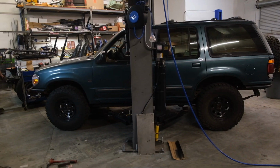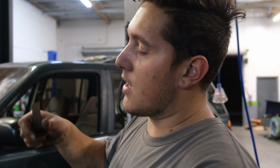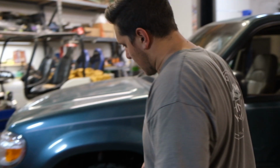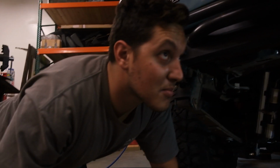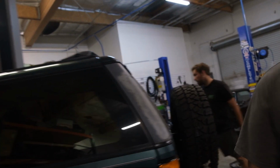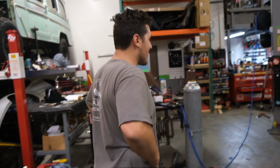Right now, it looks a little bit low on the front. Realistically, we should have tightened down the spring first, and then once we loaded it, that's when the limiting strap goes on. We'll see if we blow out those inner bump stops. All right, let's reload the springs. Back it up. What a waste of a bunch of money. Couldn't be happier. Great day.